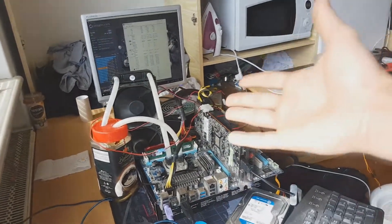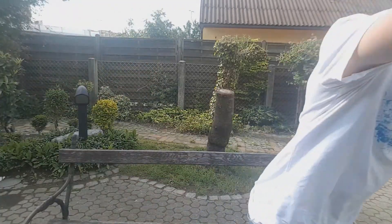So yeah, it's finished, that's it. Look at the awesomeness! As you guys could see, the water loop performed way better. When I bought this PC I got this fan and the CPU was overheating without any overclock, but now we have it overclocked to 4.6 GHz and it performs way better — it's at 60 degrees while running Cinebench. Hope you guys enjoyed the video, hope you guys actually build something like that in your own computer. Comment if you want to ask about something, and maybe send us some pictures of your own water loops. You should buy the water cooling — see you guys next time!